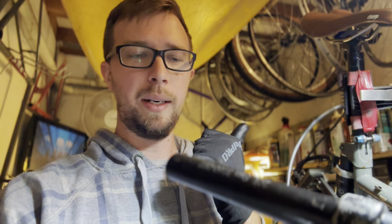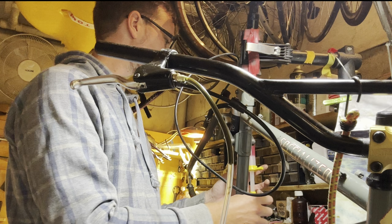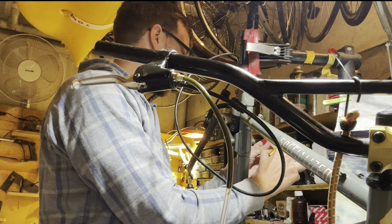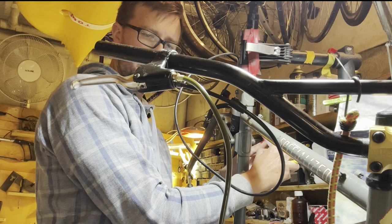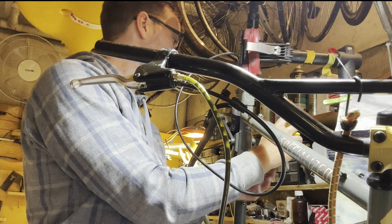When I cracked the bolt at the back end, it released the vacuum in the system, so it let a bit of fluid out here. And it looks disgusting. So apparently you don't need to hold the pistons in place. Pistons aren't moving at all. Just gonna push it through slowly. We'll see the color change up here once the new fluid is pushed through. Bunch of air. So you can see those bubbles there.